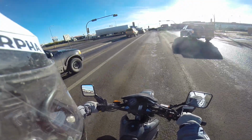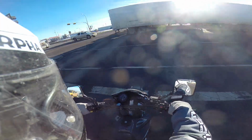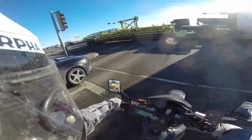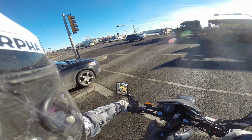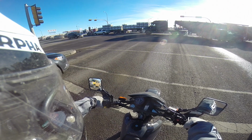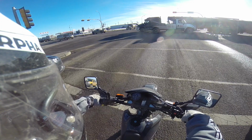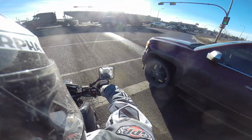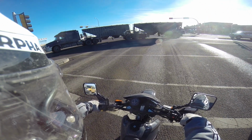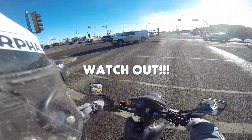I definitely ride it harder than what I ride it normally every day, and I never keep a sustained speed. I always make sure that I'm in the happy part of the rev range. If you have a tachometer, that's very easy to see. On a cruiser, you're probably going to be above 2,500, 3,000 RPM. And on a sport bike, you're probably going to be above 3,500 RPM. On a thumper like this DR650, you're probably going to be at 2,500 to 3,000 RPM and up. You just don't want your bike to sound like a tractor or like a diesel.